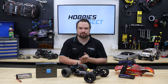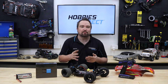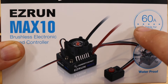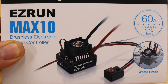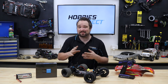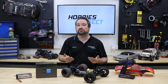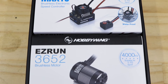Now onto the ESC. How many amps your ESC needs to be can vary quite a bit, but more is nearly always better. The amp rating — in this case 60 — generally represents the sustained current the ESC can handle. Faster motors draw more power, especially at initial launch acceleration, so this 60 amp ESC with a burst current of 360 amps will do nicely. Getting a combo is great as the motor is generally already matched to the ESC.